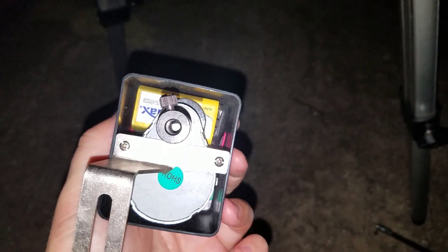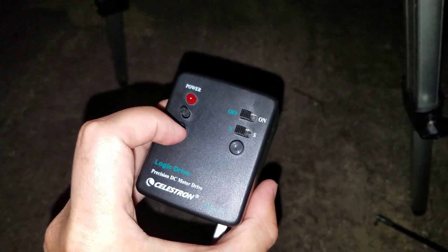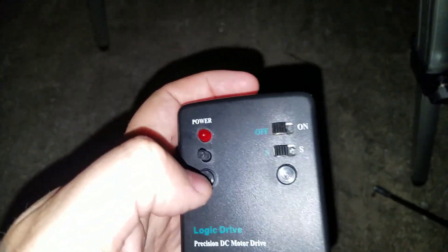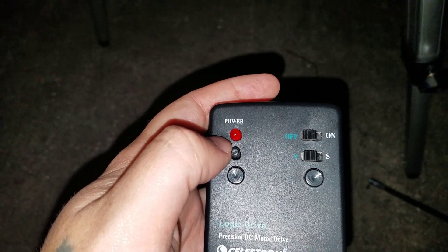It requires you to take off those screws right there on the back of the bracket, as well as these two screws in the front. These two screws here, they really don't do anything other than to hold the bracket on this front cover. So you have to loosen these up. This one here under the power button, that's actually your adjustment knob for your speed.